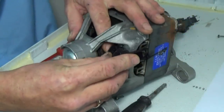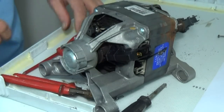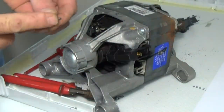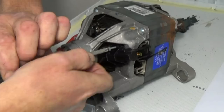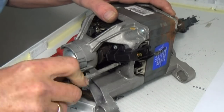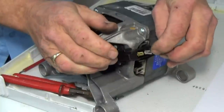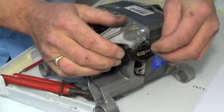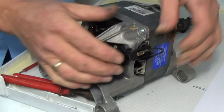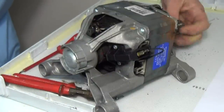You can see my finger just holding the armature and guiding the brush into place while dropping the lugs into the chassis. And again get the screw in straight away so it doesn't pop out. The carbon brush itself is quite fragile — that's why I'm emphasizing making sure you get it locked into place straight away. And there we go, both carbons are now replaced. What we need to do is just check by spinning the motor — it's all seating nicely.